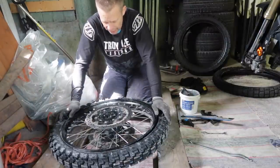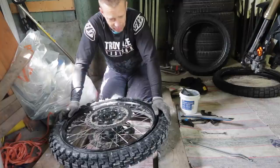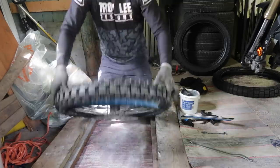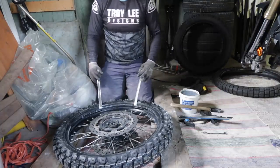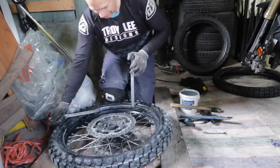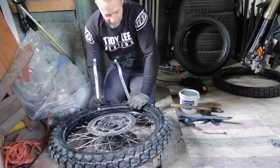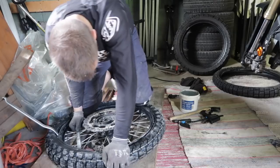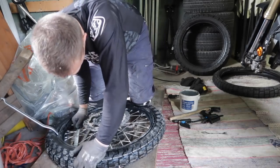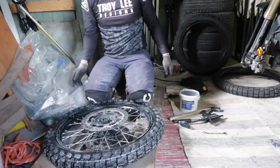I'm not going with the flow right now. I'm saying heavy duties are easier to install, and I'm saying Motoz are easier to install than Pirellis. Something's not right. And yeah, always be careful with a tube in there. Also, again with the heavy duties, they don't curl up in there. They stay nicely in place, so it's easier to not pinch the tube. Make sure that the opposite end is in the middle of the rim. Makes life much easier. We're on. Yes.